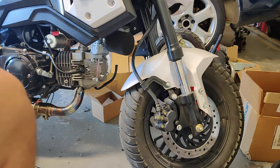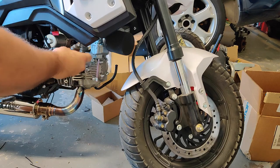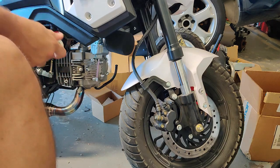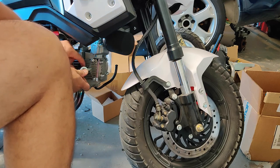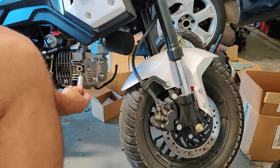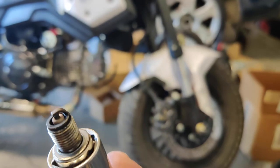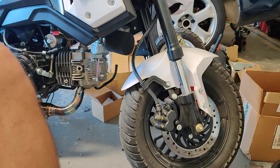I went and did a quick rip on the bike and found that my main misfires and hesitation are around quarter throttle, and I'm getting a lot of de-cel pop, which makes me think the pilot jet is too small. What I normally do is go for a rip, then shut it off mid-power range where the hesitation is happening — quarter throttle until the bike just wouldn't accelerate and kept popping, then shut it off at that moment. That way the spark plug will tell you what's happening: white means lean, black means rich. It's looking maybe a little lean, so I think I want to go up a size on the pilot jet.